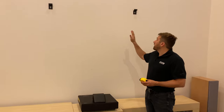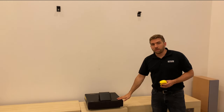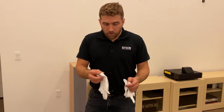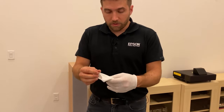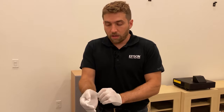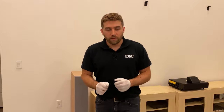This is the most critical part of the installation. The height of the brackets is determined by the height of the projector. You can go to our website and check the specific measurements for each of the different screen sizes. So far we haven't touched the front side of the screen material, which is facing downwards. This is the right time to get your white gloves on — the ones that come in the box. Get some help because you're going to be lifting the screen and you want to make sure you're not touching it with bare hands, which could damage the screen.